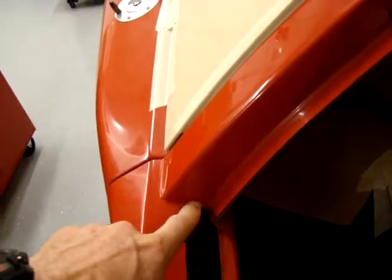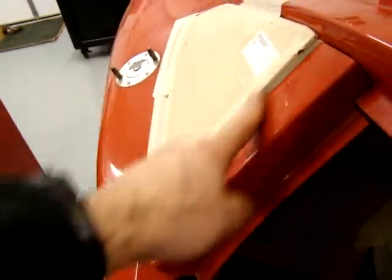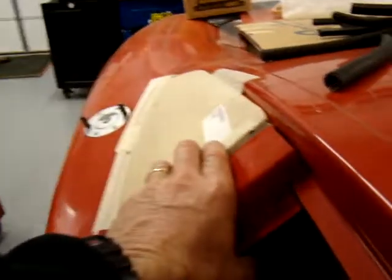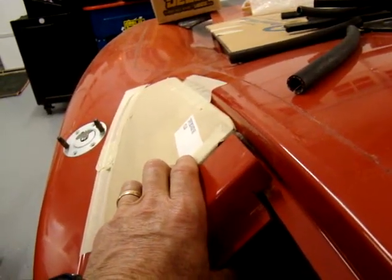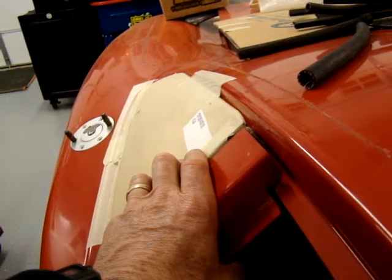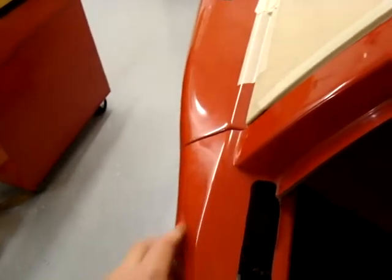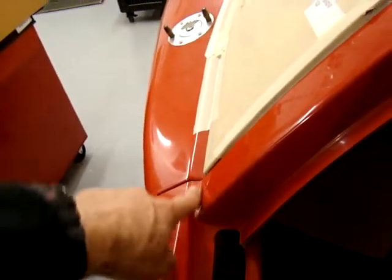The last thing I'm working on right now is figuring out how to get this pillar out. I started looking down here at where I can cut it to pull it out a little bit — this window is going to be sitting on a seal later which will bring it out even more. I could pull it out up here, but I actually have to come up even higher than what you're seeing right now. There's no way the door is going to let that thing go, so this has to be cut at the base and relocated.